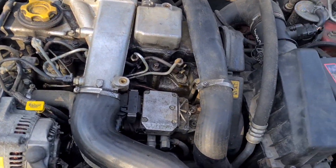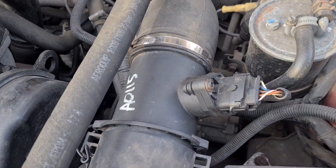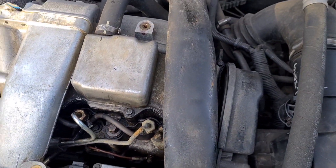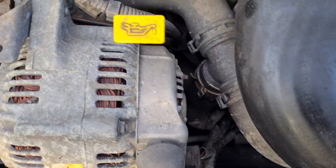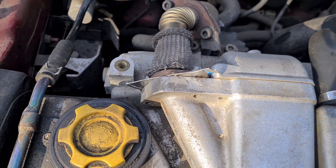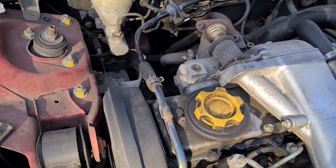This is what I've checked so far. With the engine cover off, I have replaced the air mass sensor and it wasn't that. I've checked all of the pipes to see if there's any leakage anywhere, and the EGR I've blanked off temporarily to see whether that is causing the problem — it isn't.